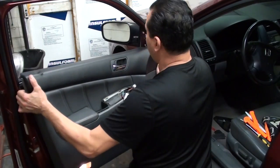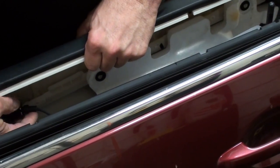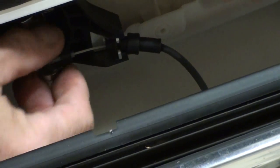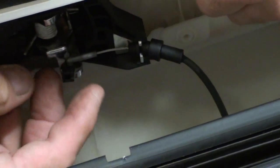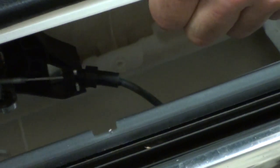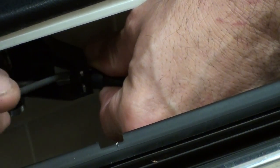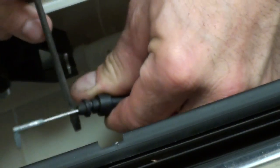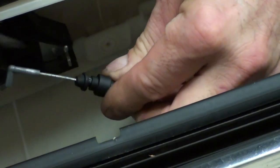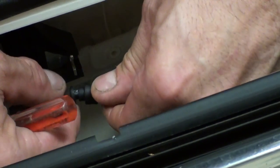So we've got the panel loose here. Now we're going to slide it up to right there — lift the panel up. There's one cable right here. First we want to unsnap this little clip right here, and then pull the cable out from the little slot that's there. I like to use a little screwdriver when I do this — get that screwdriver underneath this part and just pry it like that as you're pulling it with your hand and then it'll pull out. These tend to break right up in here, so you've got to be real careful even putting it back in. This one looks really brittle. We put it in and then we push it back in evenly.